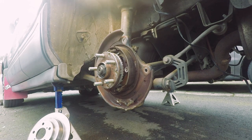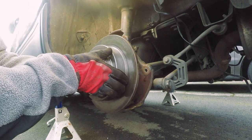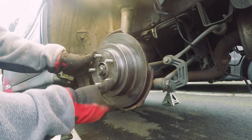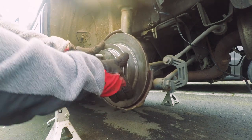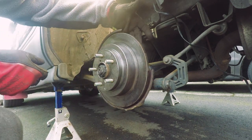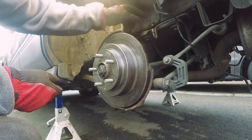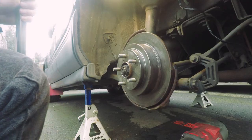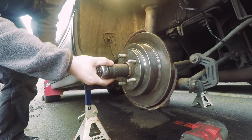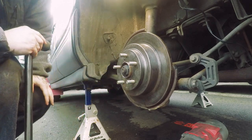We've got all the bolts tightened down except the axle nut. Go ahead and slide this on — just like that, looks like it's fully seated. Now we can put the brake caliper on, bolt that on, get the brake pads in, and run the brake line. Put that clip back in. Let's go ahead and torque the axle nut to 137 foot-pounds. Put the e-brake on.